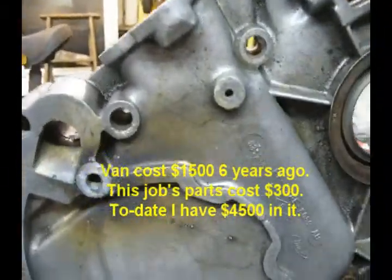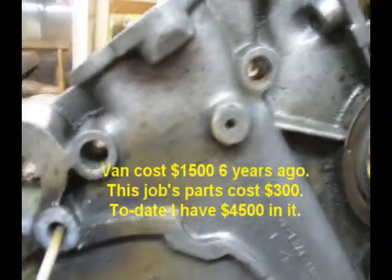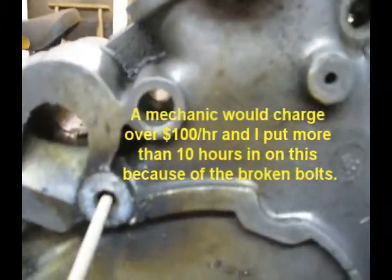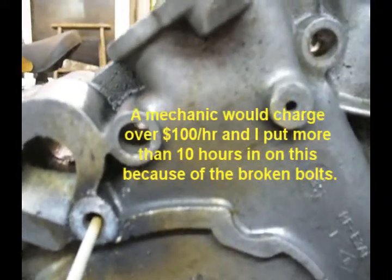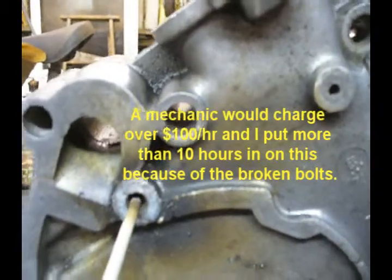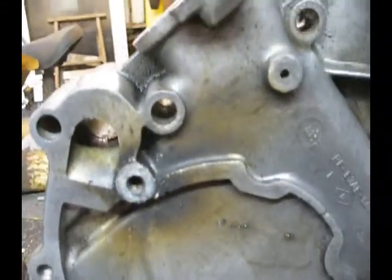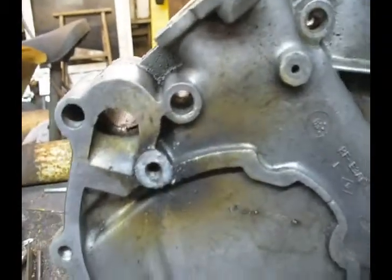I think the reason this worked is because when I used my 3/32 welding rod, I forced it down in there and made prolonged contact with the stud that was in there. Notice my buzz box can only handle a 3/32 rod. It can't even handle a 1/8 inch rod. That's how low of amperage it is.